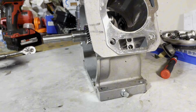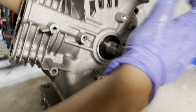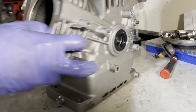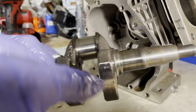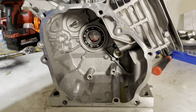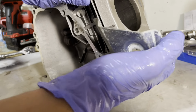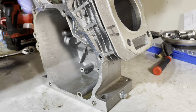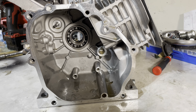Now pull out your crankshaft rotating assembly — just like that it comes right out. There's no governor gear on this side; if you want to remove the governor I'd recommend punching out the gear, which is very simple. We're down to the bare block. One thing I forgot to mention is these blocks have a heat shield that sits here — I had already removed mine before the video. Now that it's fully disassembled you can wash the block, do whatever you want with it, and then we'll get to reassembling it.